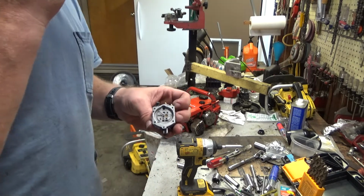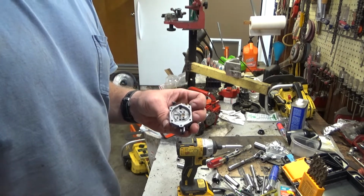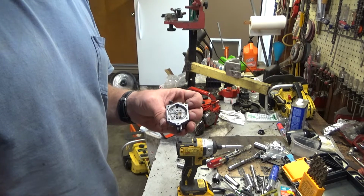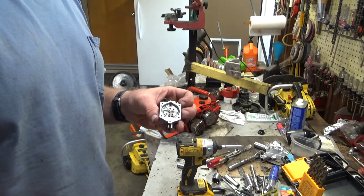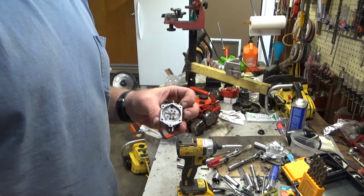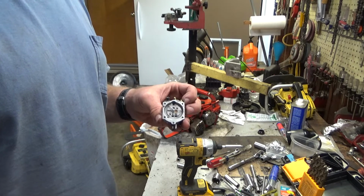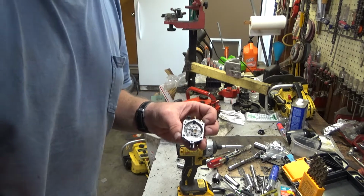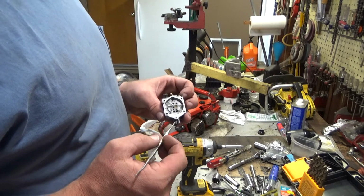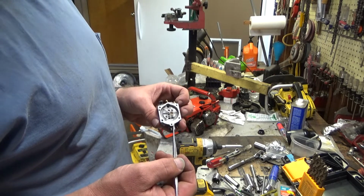The most current part number is a, what is it, 93910C, I believe, but they're getting harder and harder to find, and the guys that have them want a mint for them. Walbro does still manufacture them. Their part number is 86-520 for anybody who might need one. I sourced mine from a shop in Salem, and so far they've been a reasonable price.